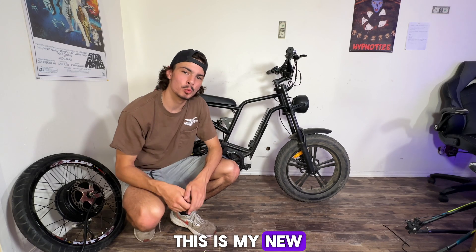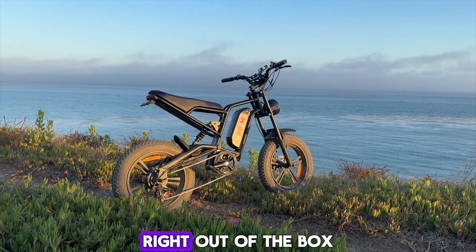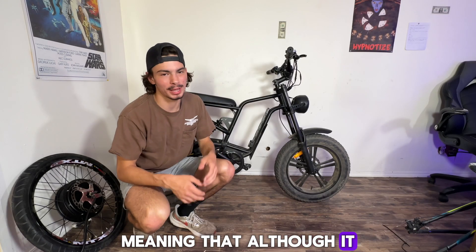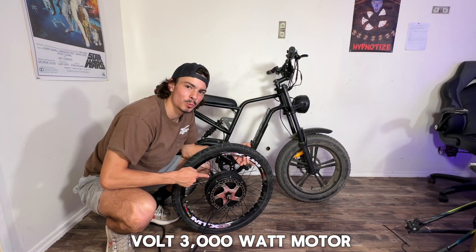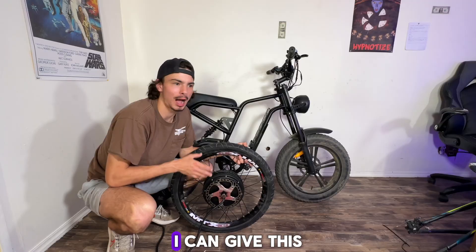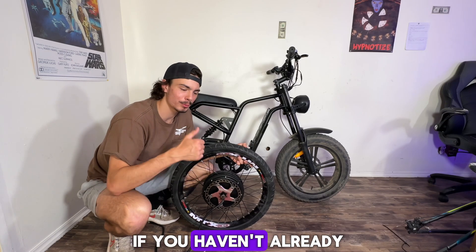This is my new Win 1 E2 e-bike. It's a super cool bike, but if I had one complaint about it right out of the box, it just doesn't come with very much power. Although it has this off-road style frame, you can't really use it for much off-roading. This is a 72 volt 3,000 watt motor, and when paired with a 72 volt ADM controller and a 72 volt battery, I can give this bike a power of 6,000 watts.